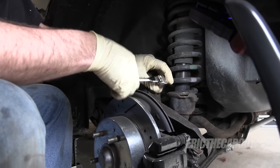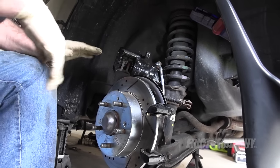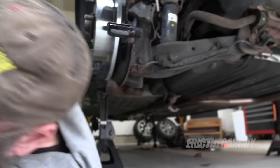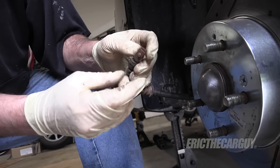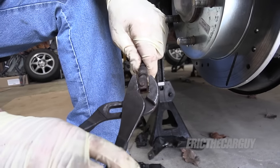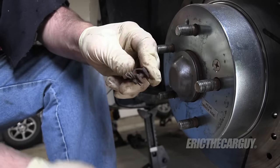I'm going to recondition the entire rear suspension with as many Honda parts as I possibly can, reusing some parts like the struts and the springs. Getting some of this stuff apart is going to be a challenge because the back of the car is usually where it gets the rustiest. Thankfully, I've recently had these brakes apart. At all costs, I don't want to stretch or stress out this brake line — it's brand new. I take penetrating oil and work the caliper pin back and forth until I can get it free, then work this pivot pin free as well. It's kind of fiddly and takes a bit, but it's worth the effort.